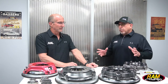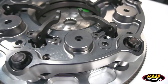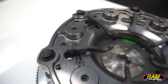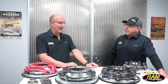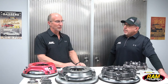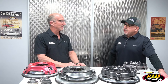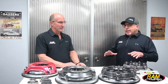The key to ring height is really consistency, because as the clutch wears the levers move and it changes pretty much the whole makeup of the clutch and the way it's going to clamp. It's important not only for maintaining the lever position and clamping behavior, but it also maintains your release bearing clearance so you don't lose that clearance and unload the clutch prematurely. Clutch tuning is a science — the more consistent you are with your setup, keep it clean, keep everything dialed in, the more consistent your car is going to be.